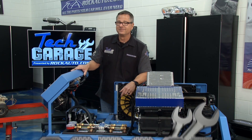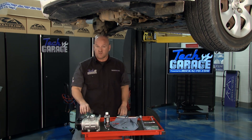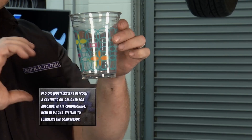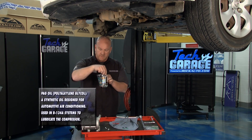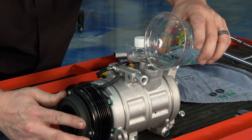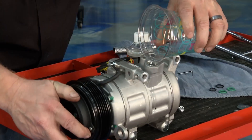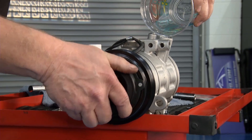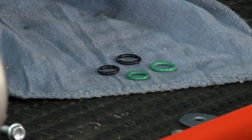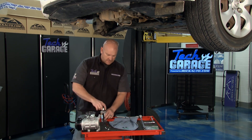There's the second O-ring off. The next step: go to John's desk and get a flower cup. I took the old compressor and drained the available PAG oil out of it, spinning it a few times to get it all out — it was about an ounce. So I took the new PAG oil bottle, put about an ounce into John's flower cup, and that's what I'm going to pour back into the new compressor. Do that gently, take your time, and as you pour it in, turn the whole clutch assembly to prime it. It doesn't take too much, but you want to get it primed in there right. The O-rings are critically important — you do this whole repair, skip the O-rings, and you're going to have greater issues.